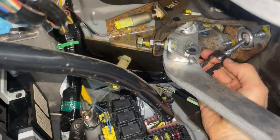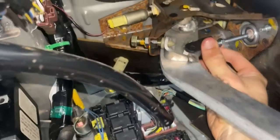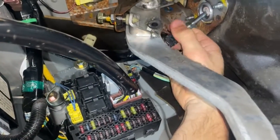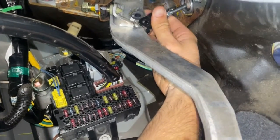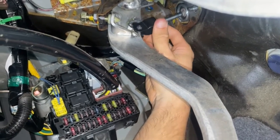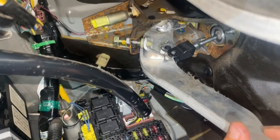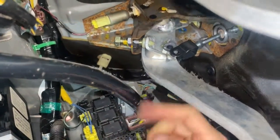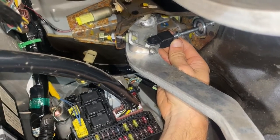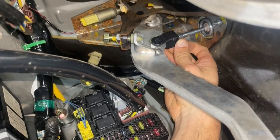So again, just going to come down here, come back up. Now that pin is pretty close. See how it likes that. So I am liking that. And right now the pedal is also all the way against the little stopper right there, and so I've got this guy dialed in. There's also some play right here. So this is how you adjust how much play there is in your clutch pedal, the grab point. And so I'm going to spin my lock nut down onto that.